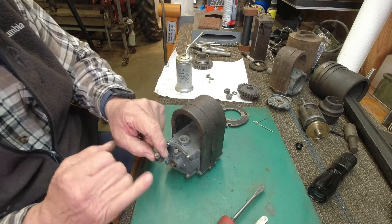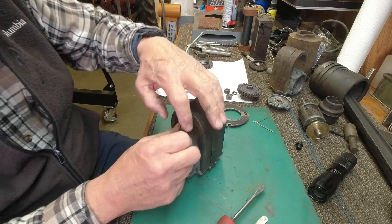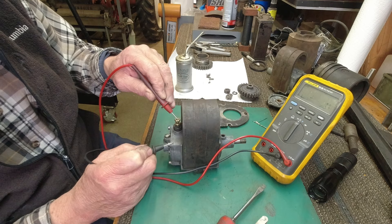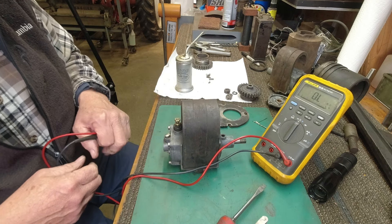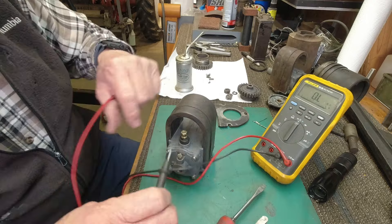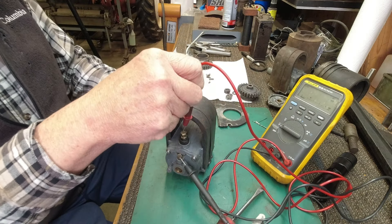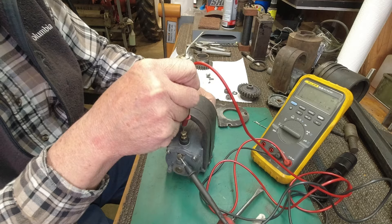I'm going to use this brush — it's nice and clean. I took a little brake cleaner and cleaned the end of it, and I'll stick it down in there. Then a test between here and the body of the mag — I should have my five ohms. Yep — five and a half ohms. That should work. If I just clip the ground in there to hold it, and put this on AC voltage, I'm going to spin it. Oh yeah — look at that! That's going to work.